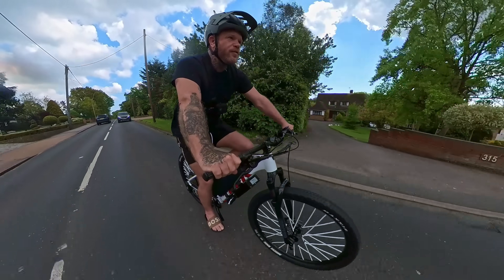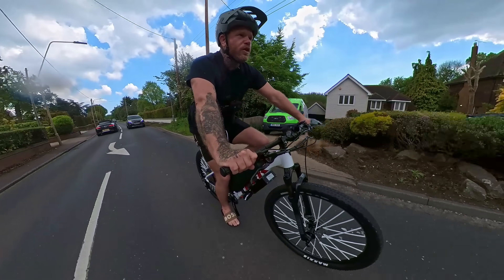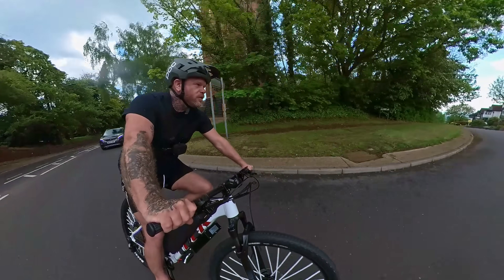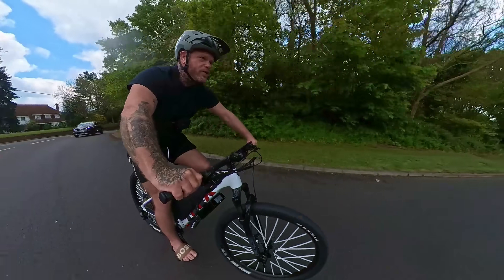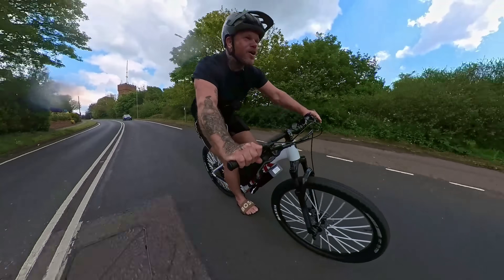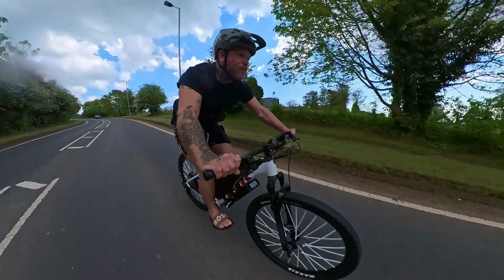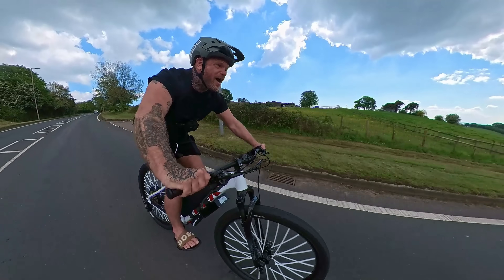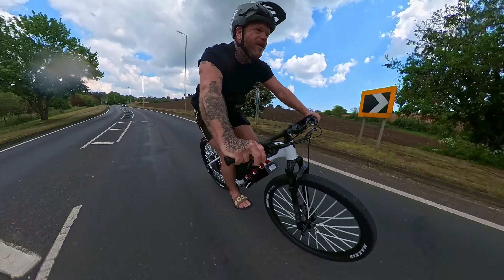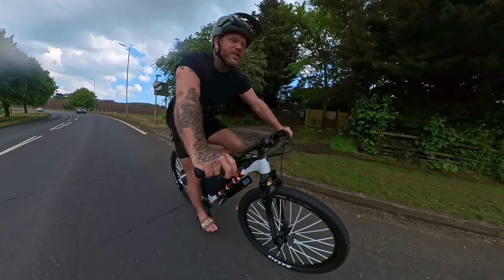I did the range calculator for this bike — I calculate it would take about six hours to do the full range, which I'm not going to do since I want to give this bike away with next to no miles on it. Calculating up to 30 amp hours gave us 97.5 miles range, so I'm estimating this goes well over 100 miles. Whoa, this thing's fast — really fast! Oh my god — 49.5... 50 miles an hour coming off the throttle! Oh my god, my eyes are streaming!